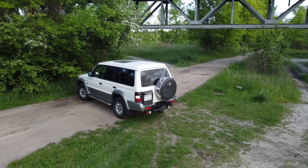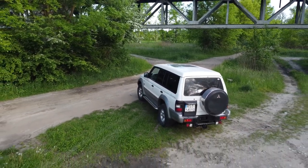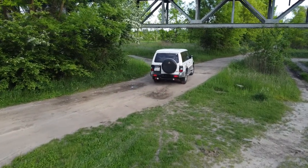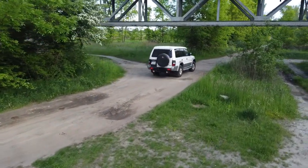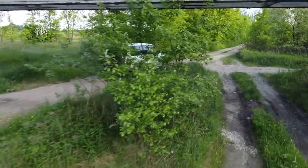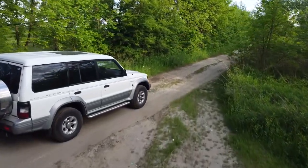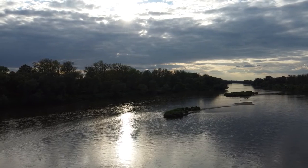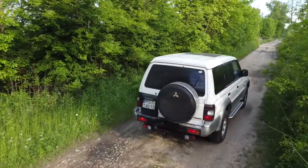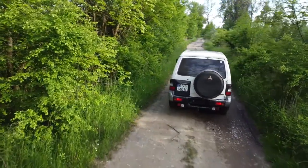In cars that are used daily, on longer roads, this problem does not occur because the car is charging while driving. But if you are not using your car every day, or it stands in the garage for quite some time, or you are only using it for very short distances, your battery is not charged enough. So, if you have a second or a third car that you use less often and mostly it stays in a garage, consider installing the main power switch.